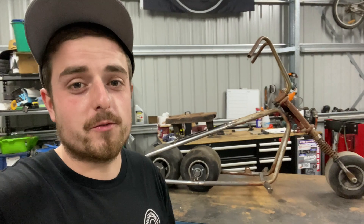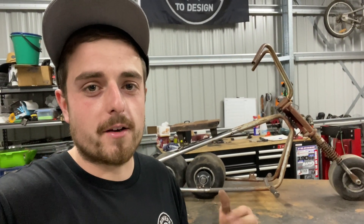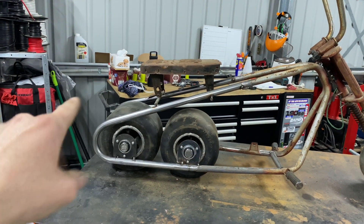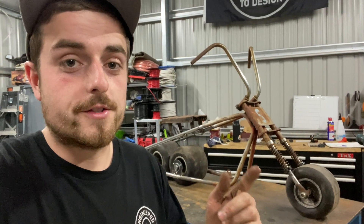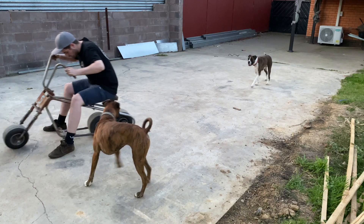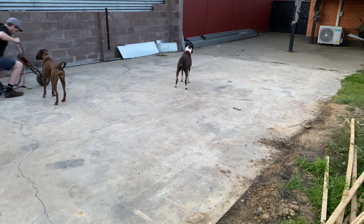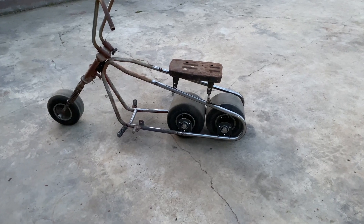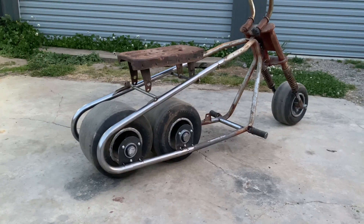This thing turned out absolute killer. Raking that front end has helped this bike a lot — it's brought that front wheel down so it's all nice and level. The chassis is level now. Has it changed the overall look of this thing. We don't usually build bikes but this is something definitely different and I've never seen anything like it. Getting this thing off the table — no need for a stand either. You're definitely going to lean into it to turn, but it does turn alright, actually not too bad. You can feel the back wheel trying to lift up a little bit, but I think once the motor's on there it might help push it forward. We did break the tack off the rear wheel so I'll have to tack that back up, but it actually feels quite good so I think we'll go ahead with this thing.